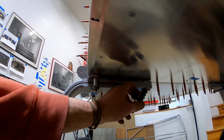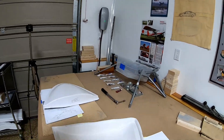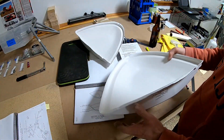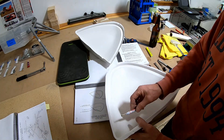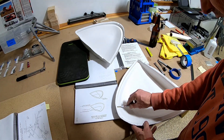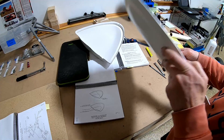Last on the agenda for the fuel lines and brake lines is getting these guys through and figuring out where's best inside here. Before I can determine that, I'm going to work on these belly fairings. It says to trim this with a little bit of a lip inside and flush, so I took one of my super skinny marker pens, put a piece of tube over it, and I can just run it along there to get a very consistent, probably about an eighth-inch gap. I can always sand it down, but I'll probably trim that with the Dremel tool.